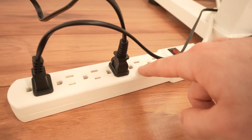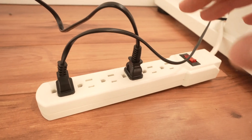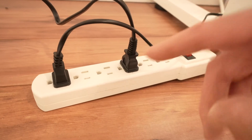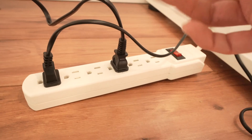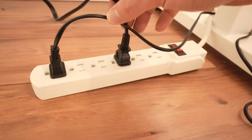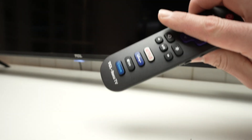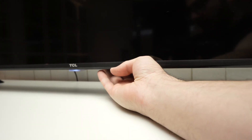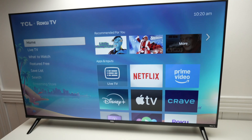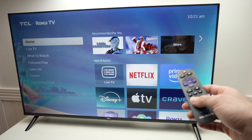Now I have it connected on a power bar, but I suggest that you connect it directly into a wall socket if possible. Because sometimes these power bars could be an issue — they don't give enough power to your TV, and the Wi-Fi starts acting up. So once it's connected, go ahead and turn on your TV, but do not use the remote control. Use the button underneath. Hopefully your TV is now able to connect to the Wi-Fi and maintain the connection.